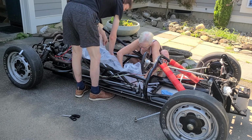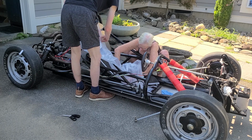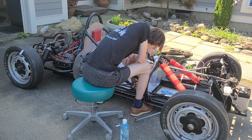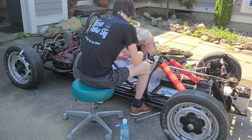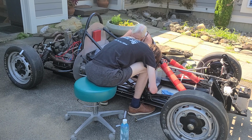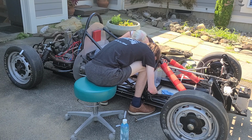That double-sided tape, as well as the bag and those foam inserts, are all provided in the kit from HMS Motorsport. So we are just very carefully pressing the bag onto the seat, making sure that we don't have any pieces that are bunched up, making sure we don't have any major wrinkles or anything like that, because all those things are going to be reflected in the shape of the seat once we pour the foam into it. So we just went back quite a few times and made sure we were really thorough, pushing the bag flatly onto the seat. And that's what we're doing here.